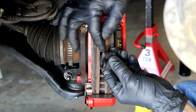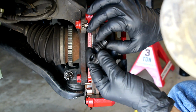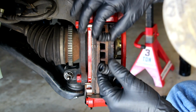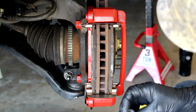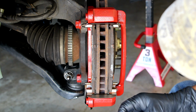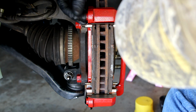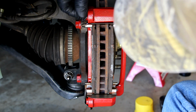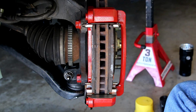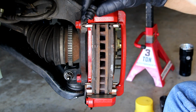They have this little knurled top on them. That goes towards the slider itself. The other side locks into the actual mount. So we're going to put those in first. I'll go with the bigger one on the top and the smaller one on the bottom, and that's diameter-wise. So put the top one in here, slide it on, and try not to do that. Then fit them on here, and then we're going to lubricate the pins and put them on.